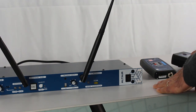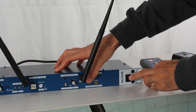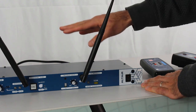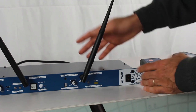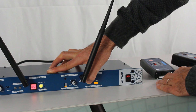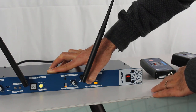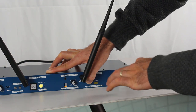We turn off the station. Now we are going to press this register button, and while keeping it pressed, we are going to start the base station. We will keep it pressed for another 15 to 25 seconds until all LEDs on the base station blink, giving us the information that the reset procedure has been successful. So let's do it — we press the register button, then press the on/off switch, and we will just wait approximately 15 to 25 seconds. Now you will see all the lights of the base station have just blinked simultaneously.